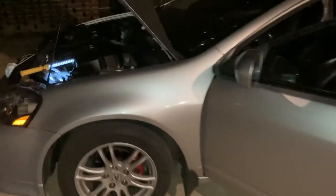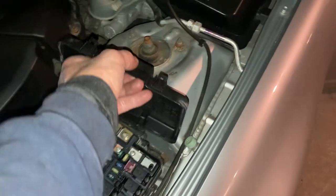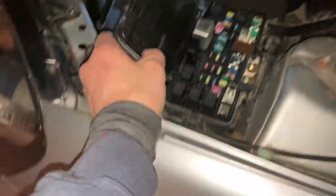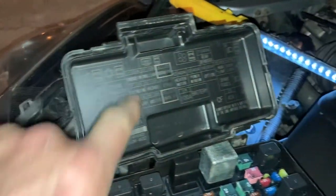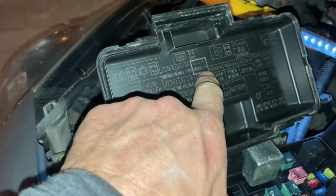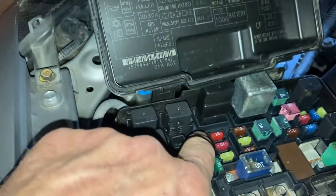There's another one. Under the hood is where my problem was, and I'll show you that right here. Here's my son's car — it's an 05 RSX. If you come here to your fuse block under the hood, don't flip it this way because it got me backwards. Flip it this way and it'll keep you referenced to your panel — that was kind of a dummy move on my part. But if you look right up here, they all correspond, and it's going to be your small light block. Not your interior lights — it's your small light block. It's a 10 amp fuse and it's right there.